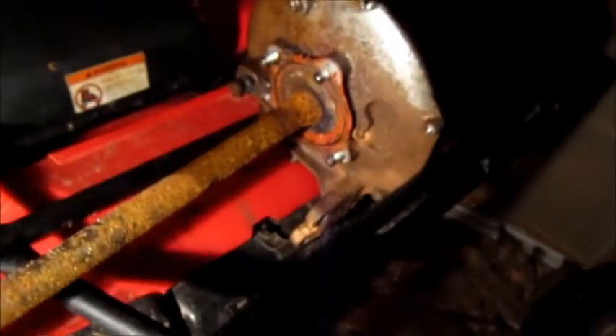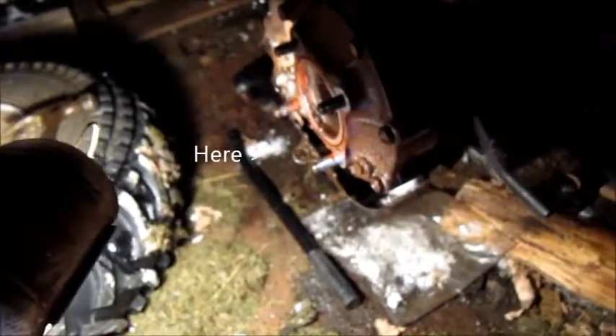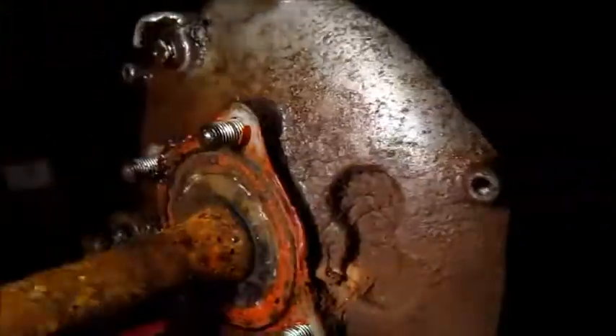I'd like to present the axle out of a 350 Rancher. We had to take the axle cover off, remove the brake assembly with those four bolts, and the axle assembly with those four bolts. There's one particular 12mm bugger lined up with the floor that's a real problem, plus four 14mm buggers. With all that loose, I can get this inside and see why this stubborn drum won't come off — in properly heated conditions instead of relying on that propane heater.